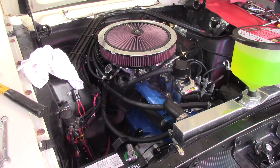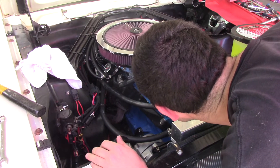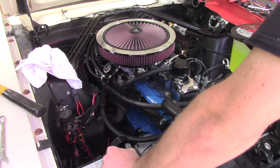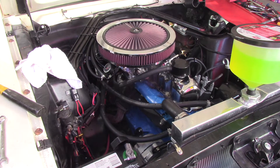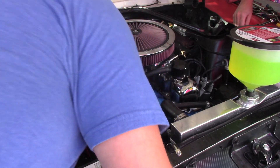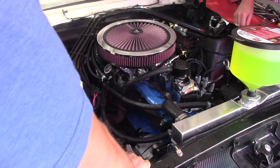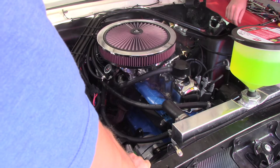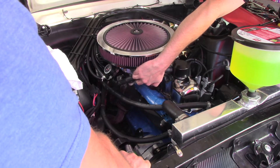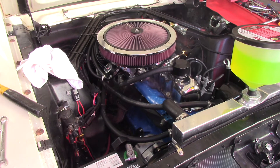It's burning off a lot — I don't know if that's the paint burning off or the oil. Probably a little column A, a little column B. You did just put this together. I used a lot of that ARP stuff. It doesn't smell like oil — it smells like something else, could be paint or the new gasket material. How long did this motor run since it was built? Half an hour, 45 minutes. They smoke forever. The idle AFR is actually staying really nice and steady. Okay good — that means it's not leaking then.